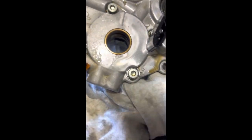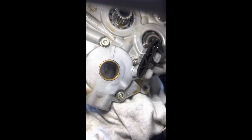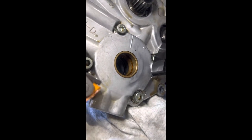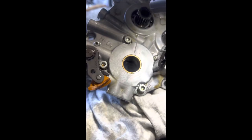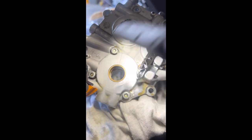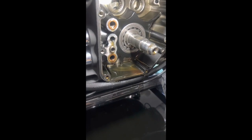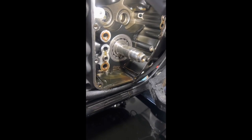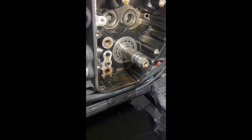Other things to look for: we have got a brass bushing in the end of the cam plate. The thing is with this, it will determine what our crank runout is. If the crank runout is sitting out of where it's meant to be, you will see marginal wear and scuffing inside that bush. It is replaceable, but I'll do a quick runout anyway just to see where it's at — it's good for a rule of thumb. You can check off the hand and the nail if we're seeing lines and typical wear. There's no metal or debris in the bottom there, so just stuff like that — these are little checks you just do on the way.